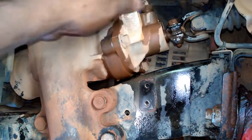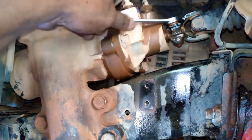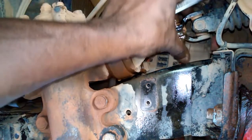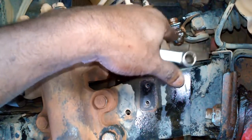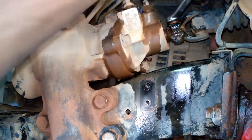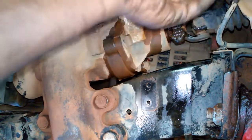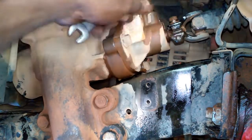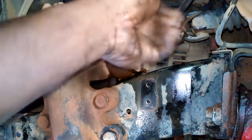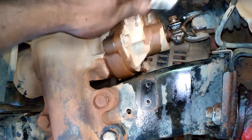You might be asking what position the steering wheel is in. The steering wheel is in a straight-forward position with both wheels pointing straight ahead. You don't necessarily have to mark it, but you could use paint. Once you have your center link and pitman arm set to the marks, this shaft will be reinstalled according to the steering wheel's straightness — or rather, according to how the wheel is balanced. Sometimes the wheel is placed in the horizontal position, and we'll address that when reinstalling the shaft.